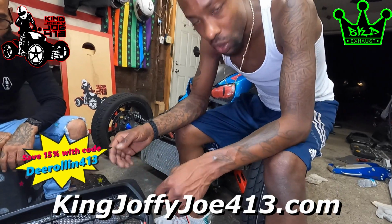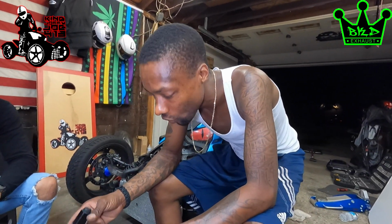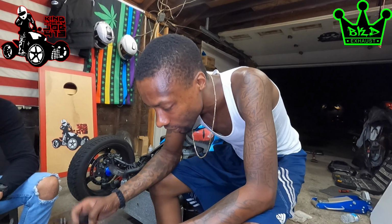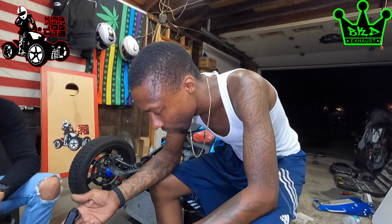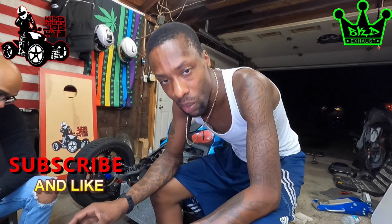That's quick access. So when you turn your bike off, the lights automatically go off, but we still have the switch on there. So if in the daytime he's riding and he doesn't want the lights on his grill on, you can just turn them off. We're gonna hook his fog lights up to these as well, so the fog lights and the grill come on at the same time. If he ever wants to turn them off, you can turn them off and on. But if the bike turns off, all the power is gonna be away from everything.